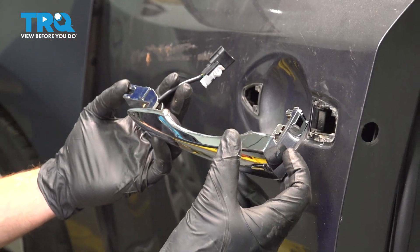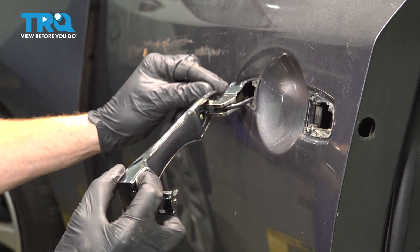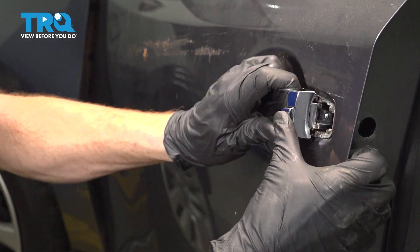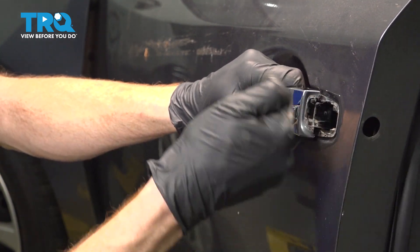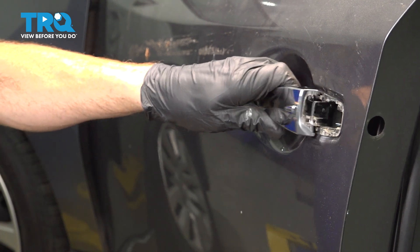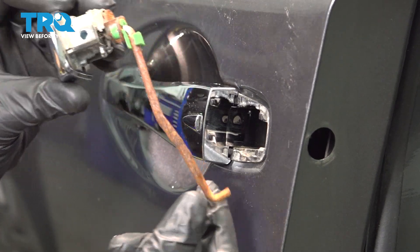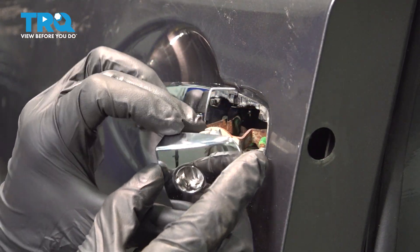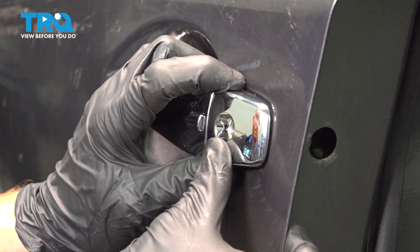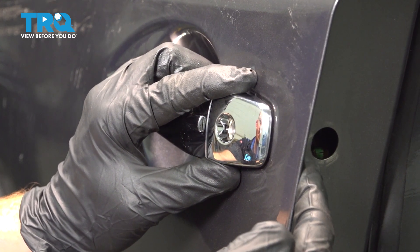Now let's prepare to install our door handle in the vehicle. We'll start with that wiring harness, sliding it right into the door. Take this end, bring it in at an angle, continuing to slide it in towards that lock hole. Once we have this pressed in as far as possible, we'll be pressing it forward towards the front of the vehicle. Listen for a click from that and give it a nice tug to make sure it is properly secured. Now let's install our lock assembly — take the rod and slide it down into position. Press it in. With that pressed firmly against the door, we'll continue on with our T25 Torx screw and make sure that's nice and tight.